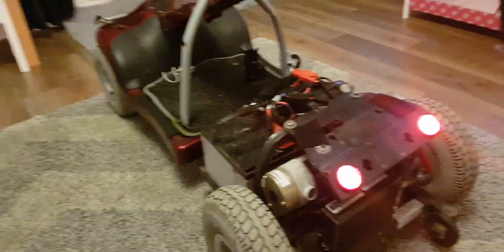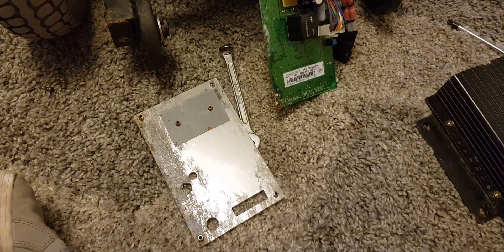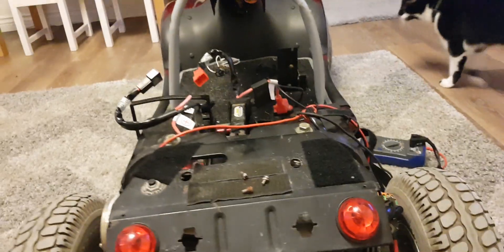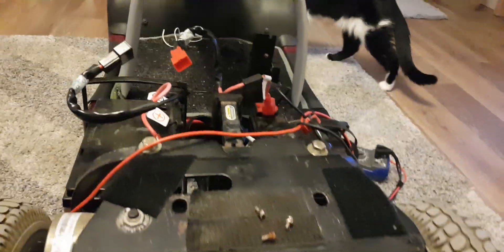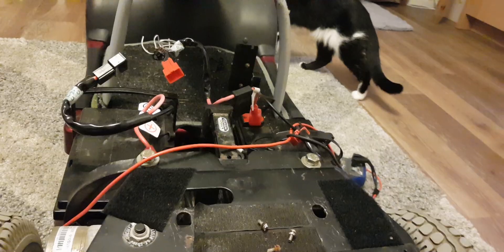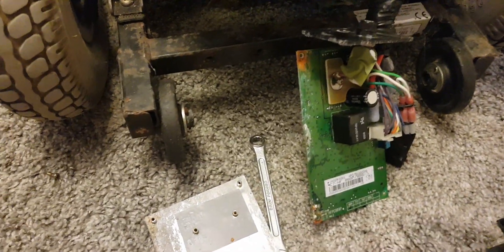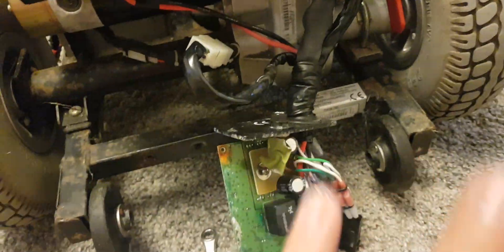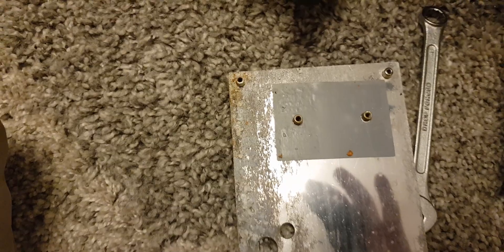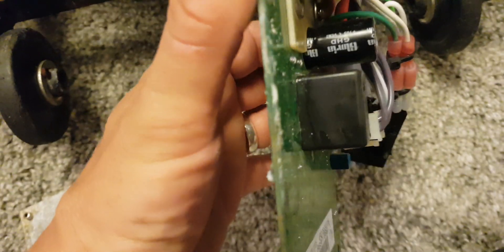I'm a little bit further into this after messing around checking all the electrics. I was getting voltage down to the throttle pedal and it was changing voltage, so the speed controller should have been seeing a change in voltage. I checked all the wiring all the way out, checked everything back here, and couldn't see the problem.